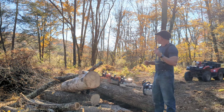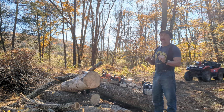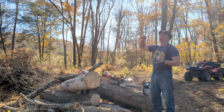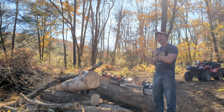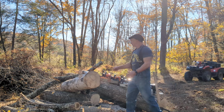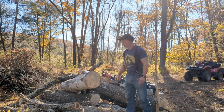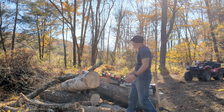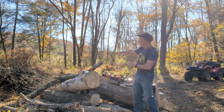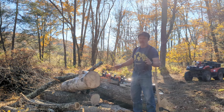The one thing I will say is I didn't do that chain originally on that 357. On those rakers, you have your hardwood setting, your softwood setting, and then 20 thousandths lower, and that chain is 20 thousandths lower. So that chain is wicked aggressive. This piece of ash is a nice, hard, dry piece, so we'll see how it cuts. I got another piece back here, and I don't know how that is, so I'll give it a try. I threw some logs on the back because I was just dumping them off the forks over here, and it was janky, not thinking of a video.